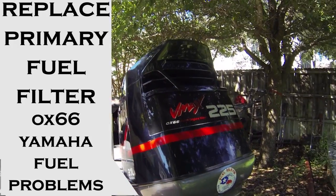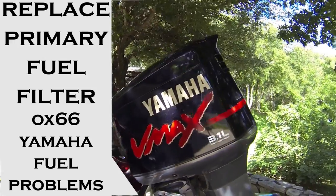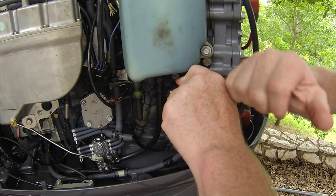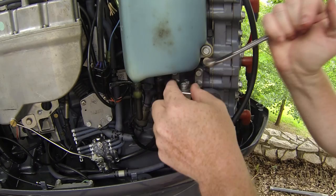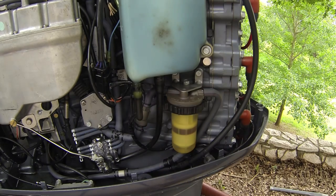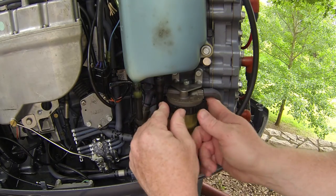These are some of the issues that you could be going through with your boat. Right here is your fuel bowl — I changed the filter in here. I don't have the little red ring that lets you know how much water is down there, but when your boat's sitting long enough for the water and the gas to stay separated, you will see a clear, definite line. If you see anything in there, just go ahead and empty it out.